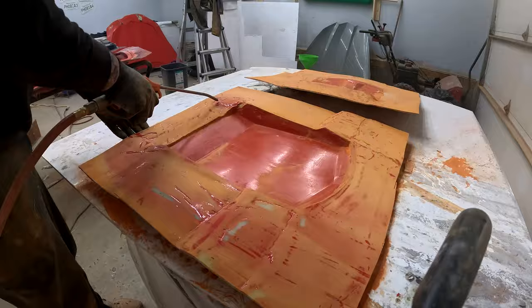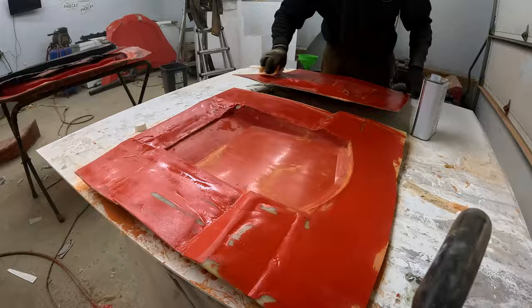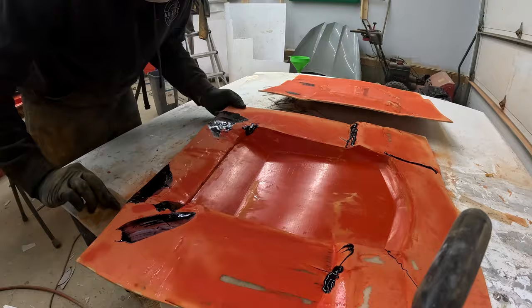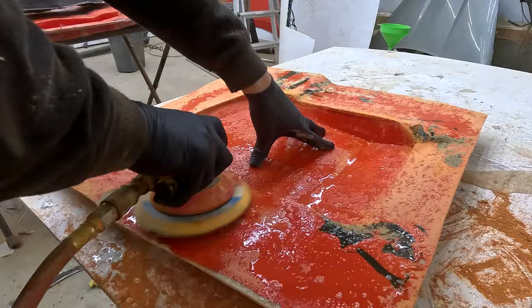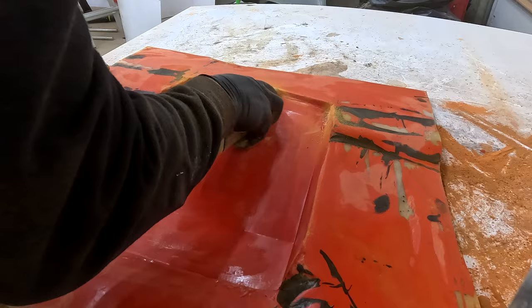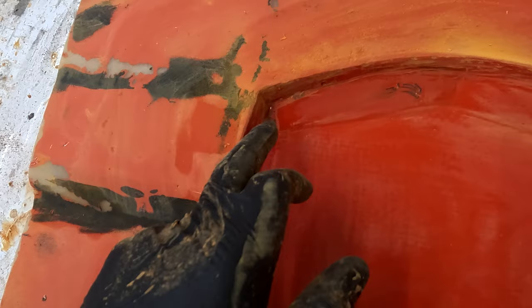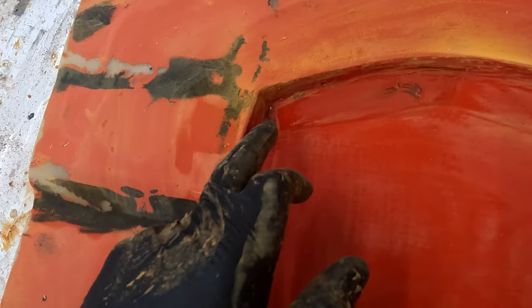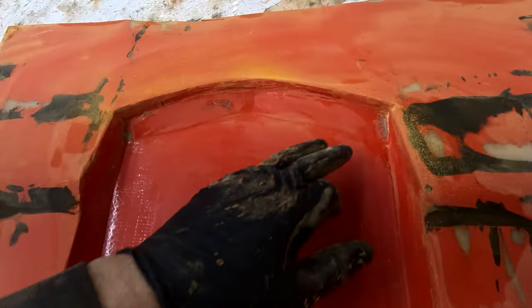If you're wondering what I'm doing here — I'm sanding in 40 grit. It's a little aggressive but it is pretty rough. It doesn't matter if it burns through the primer because the exterior part — we just need the gum tape line to be smooth. We're going to go around and sand this, then sand in here too, probably hit it with a 220 or 320 and end up polishing that. Another problem: we've got a pretty good hair gap there that we tried to avoid. There's not a lot of gel coat — it's pretty thin. Rather than mix up gel coat, I might just put epoxy on there because it does sand and polish nicely.